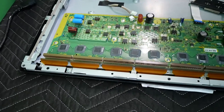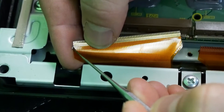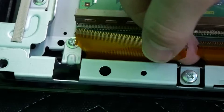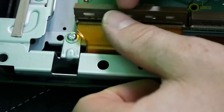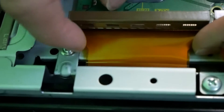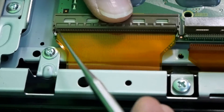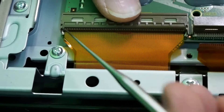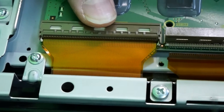Now to reinstall all of these ribbons, I want to pay special attention. There is a little tab right here on both edges of each connector, and that little tab needs to be inserted far enough into the connector so that it clears a little ledge. When I put it in, I'm going to wiggle it in as far as I can until I get resistance, and then I'm going to close the tab. I need to make sure that that edge piece cleared this little piece of plastic — that'll tell me the ribbon is inserted far enough.